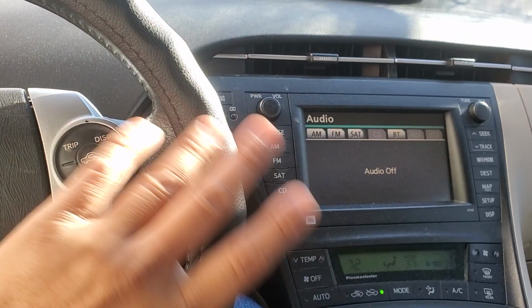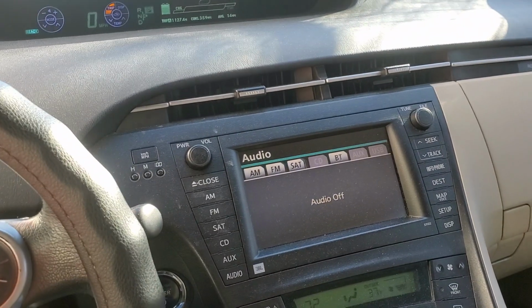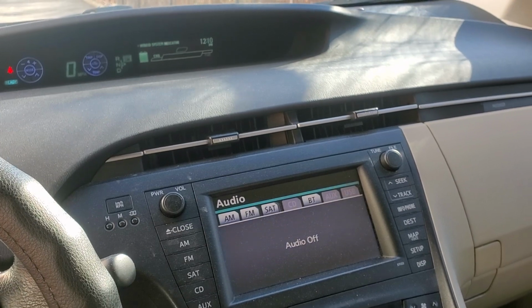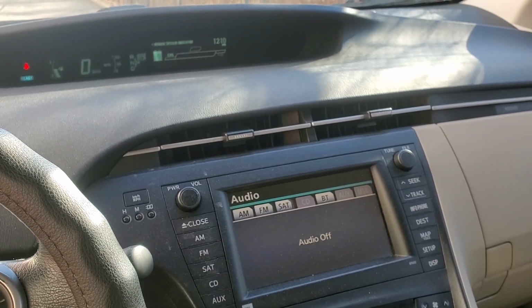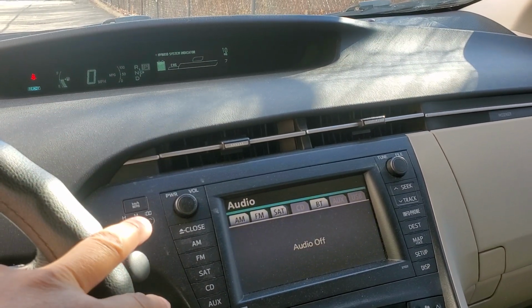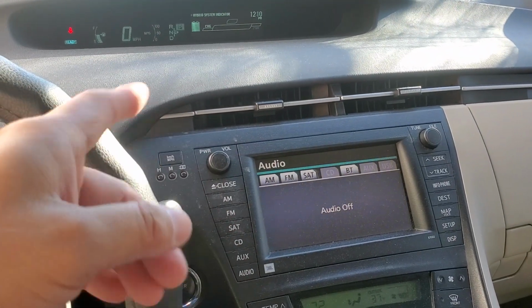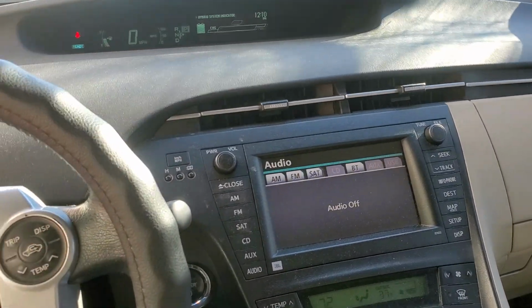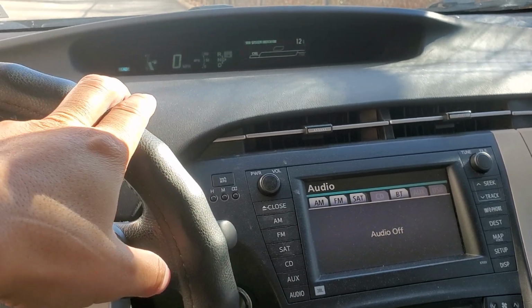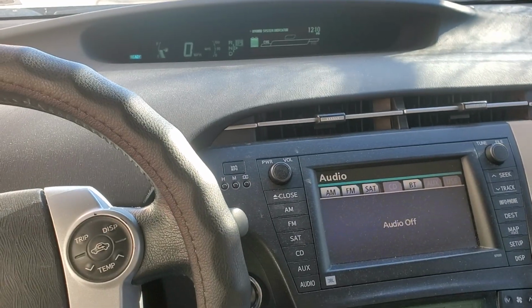For the most part, the car works fine. Now, my MPG, since I had the whole install, is 35.9. Not very good MPG, but it's not like it's been operating at optimal, because when the check hybrid battery light comes up, the engine wouldn't shut off. It would just keep on running. And I would have to do the steps to actually reset the computer so that it wouldn't just keep on running. And I think that eats up some gas.